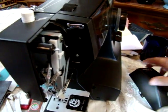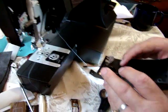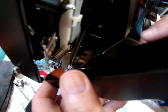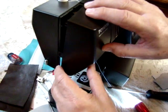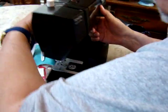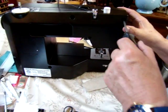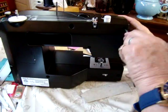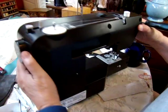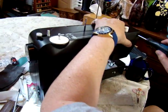Once you've got it all lined up, you're good to go. Then we put this little door back on. If you look at this door, you have this pin here — that's what they call the positioning — and you want to have that lined up like so, then just push down on it. Get it over here, there's a lower clip, push it forward, get it lined up, and then put that screw back in. That's how you make that adjustment. It rarely happens, but if the needle is hitting the needle plate, you'll know what's happened. Tighten up this back section and you're done.